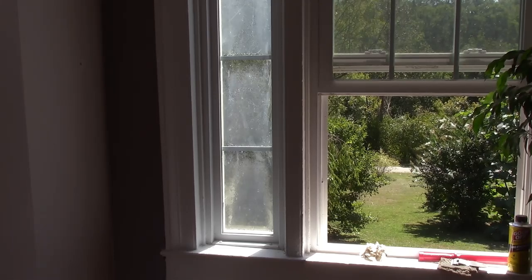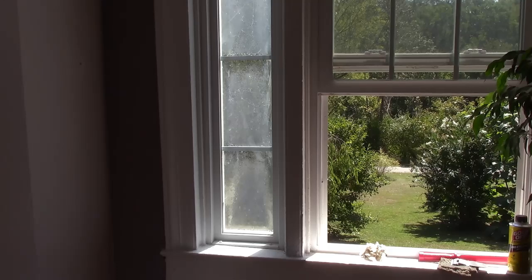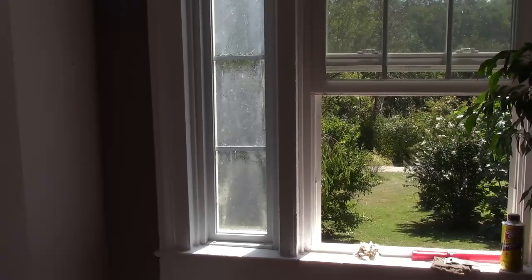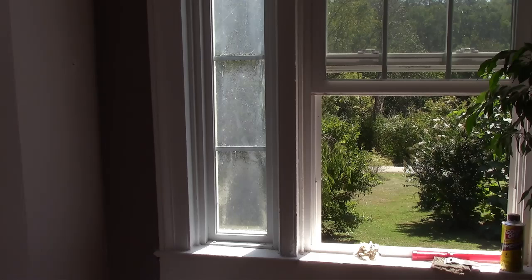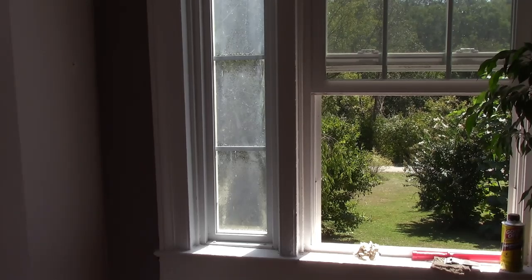Sorry we didn't get to finish the job, but we kind of did because you got to see exactly how the window goes in there. Acetone helped on the glass with a 3M Scotch-Brite pad - wet it and scrape with a razor. Nothing really helped getting that sticky stuff off the vinyl though. The window is back in place and it didn't break, so I guess that's the most important thing. I'll catch you guys on the next project.